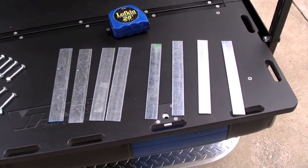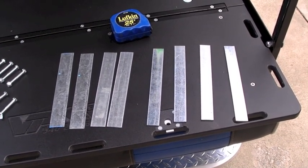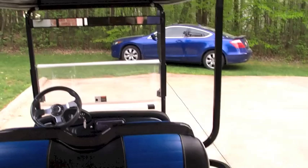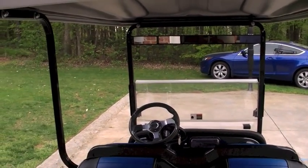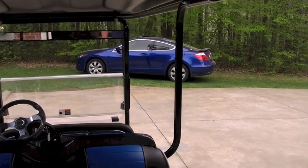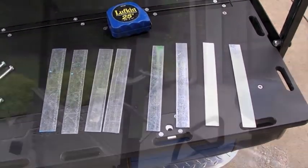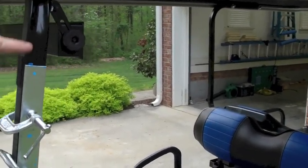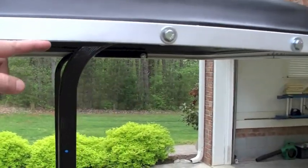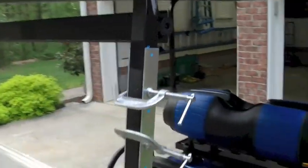Now I have all my steel pieces cut. I've selected nine inches each to give me an appropriate drop. On the lifted cart that I'll show at the end, I used 15 inches because it's a lifted cart and I needed a little more drop. I've measured around and put a mark on the front five inches down from the roof, and in the back, because the back sits a little higher, I've gone six inches. That's where the top of each brace will sit. All the braces are nine inches.